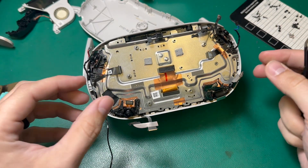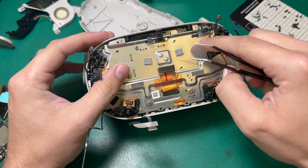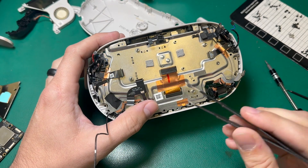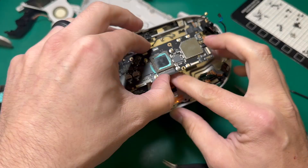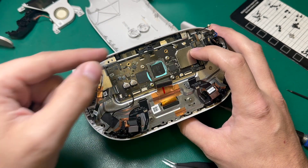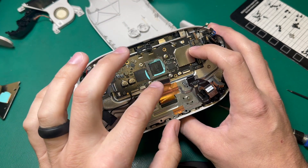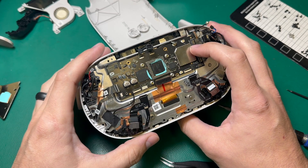I've got my two speaker wires, my power button, WiFi antenna 1, power cable, WiFi 2, my proximity sensor and LED indicators, cameras, and charge port. I can go ahead and screw this back in, and then we can start putting the motherboard back. Before screwing in, confirm that all cables are on the outside — it's a real pain if the WiFi antenna, proximity sensors, or LCD connector end up behind the motherboard when we screw it in.